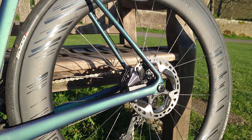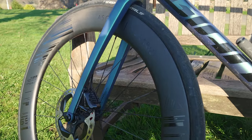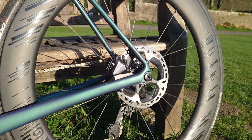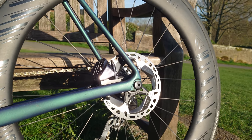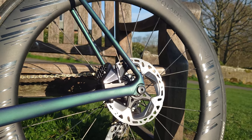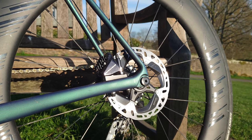That's quite high speed. If you're going to limit yourself to a lower speed and do more braking, or you're a heavier rider, that wattage figure just goes up. So are these things really designed as they should be? I'm not so sure. We've got the envelope right on road and it is hard to really do anything in this 160mm envelope. But I am going to have a shot at this — I'm working on my own road disc project, so keep your eyes peeled. All will be revealed in the very near future.